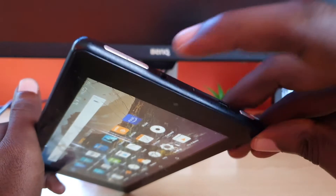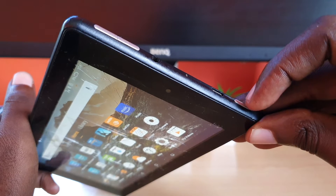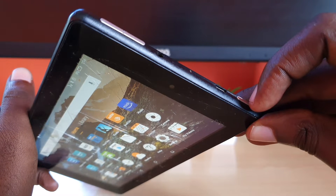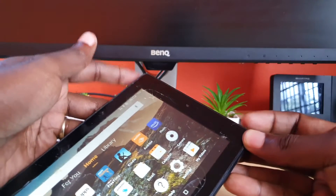This device is fine right now, so I'm only demonstrating. You're going to locate the keys on the side — there's power, and up here you have volume down and volume up. The key is to find the volume up and power key. You're going to hold both of them and hold indefinitely until the device simply reboots. You'll need to hold for about 30 seconds or so, give or take.